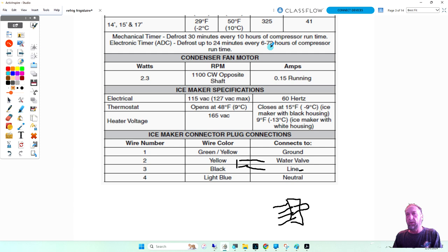If you defrost all the ice off the evaporator, which you need to do anyways when you change the heater, so defrost all the ice while you're there, you've got 5 to 6 days before enough ice builds up that the customer is going to start having cooling problems. It's going to give you 5 days to get those parts and come back, and the customer's fridge is going to work fine.